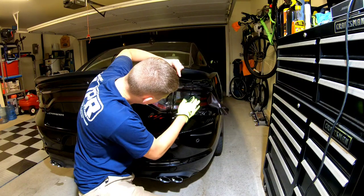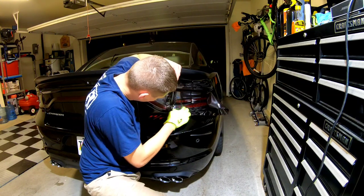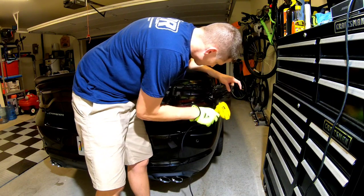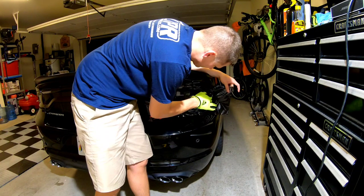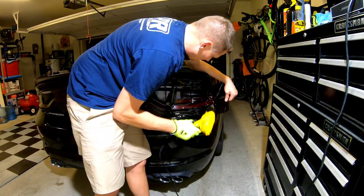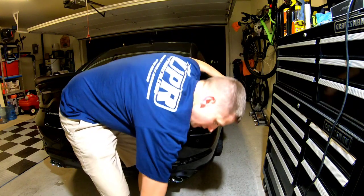Give it all I got, Captain — it's going to look pretty nice. This is probably the harder corner right here. It's going to kind of pull the film outward, just kind of laying it in there. There's still a lip on the back of this lens. Heat is your friend. I am using the lowest setting on the heat gun — there are two settings, low and high, and I'm just using low.